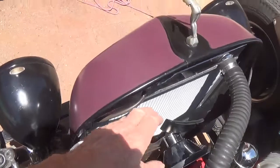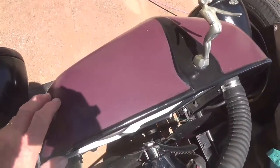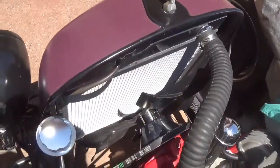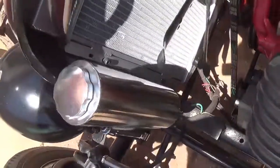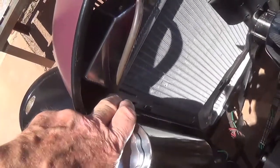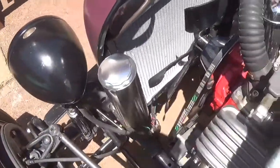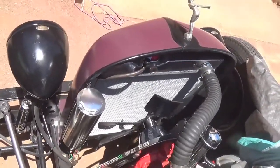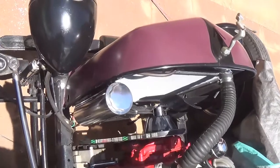Here's the finished view. As you can see, the aluminum radiator now fits completely within the grille shell — it's not protruding out the back. And here is that overflow tank. I had to fabricate a steel bracket for it that mounts it securely to the radiator aluminum housing so that it can't drift over and get into the fan blades, which would be rather unpleasant. So that's the final product, and I think it's going to not only look a lot better but work a lot better.